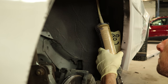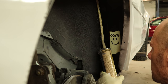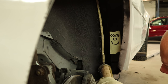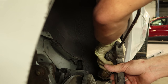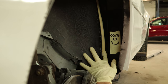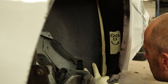Now we can replace the seam sealer that was cracked inside the wheel well. We scraped all the old stuff out and we'll put some new stuff in. Everything was primed and painted inside the wheel well, so we're just putting this over it. Then when it dries, we'll hit it with some undercoating and it'll be just like the factory. We'll get our seam sealer in the bottom there — the factory just kind of puddles it up. We'll use our finger to smooth it out. Actually it looks a little better than the factory.